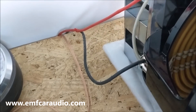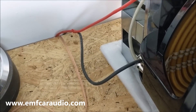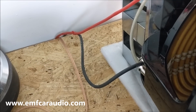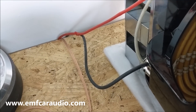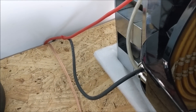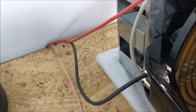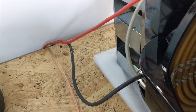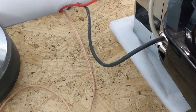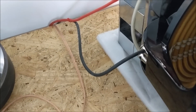Remember to use proper gauge speaker wire. You don't have to use 8 gauge on everything, but at 1,000 to 1,500 watts you probably want to be larger than 16 gauge. 12 gauge will work fine for any of those, and actually pretty well even higher than that. You also have to consider the length of the wire — these lengths are about six or eight feet down to the amp. You certainly don't need 4 gauge on pretty much anything, but 16 gauge — leave that for your 600 to 800 watts, maybe a thousand watts for mids. Otherwise you want to be in a larger size.